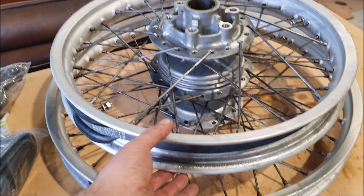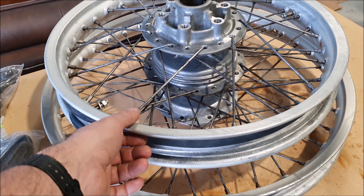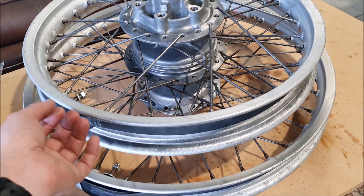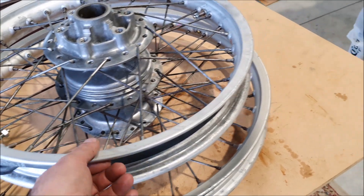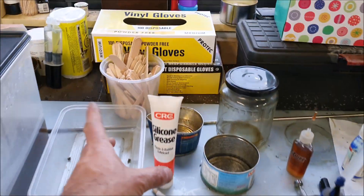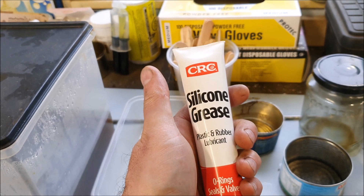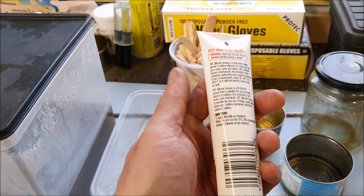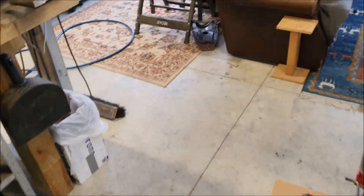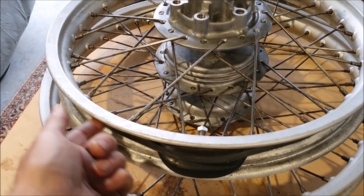For lubricant — I didn't get the tire lubricant because they were going to charge me an extra 10 or 20 dollars for dangerous goods shipping. A lot of people just use dish soap and water, but apparently that can cause problems because it's slightly alkaline and will eventually rust the aluminium. I decided I'll use the silicone grease that I've been using on the rubber hoses on the Riley — somebody suggested it and it works well. It's designed for rubber, doesn't attack metals or aluminium, is nice and slippery, and worked really well on the hoses on the Riley, making it dead simple to fit those. A little smear all the way around should work pretty well for the tires.